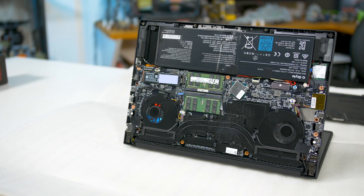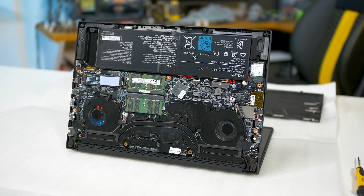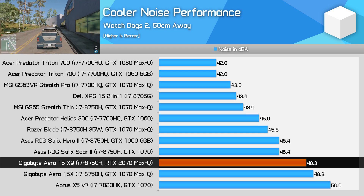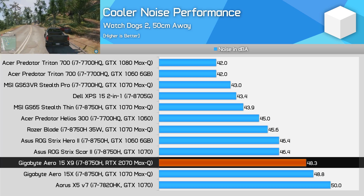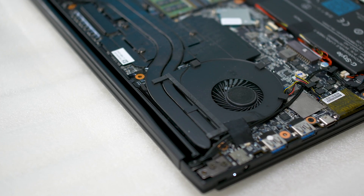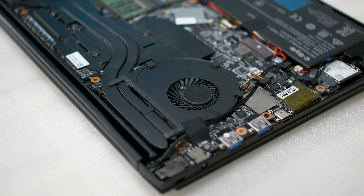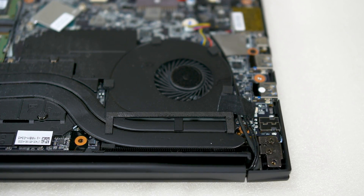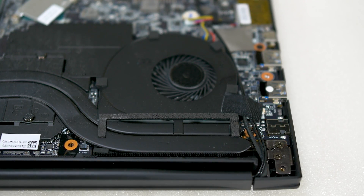While the Gigabyte Aero 15 performs well for its hardware, the cooling solution isn't amazing. To deliver top-end performance in line with other systems, the gaming fan mode should be used, which really ramps up the fans to a high degree. This mode is loud at 48 dBA, which keeps the Aero 15 at the bottom of the chart as one of the loudest notebooks I've tested. It is an area the AI mode could really help, except it simply doesn't perform as well as the loud gaming mode. Noise levels while using the laptop for productivity tasks are a lot better — still not a quiet system at a touch under 40 dBA during a Handbrake encode, but this is mid-tier among gaming laptops. This is using the normal fan mode, as the gaming mode saw no additional performance increases for CPU-limited apps.